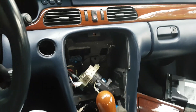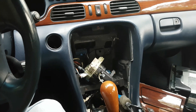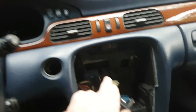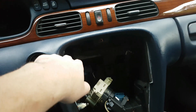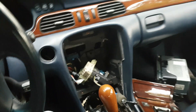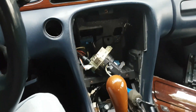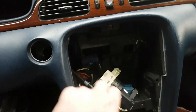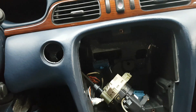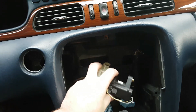I went to YouTube and couldn't remember if I'd used a video to figure it out last time, but as far as I can tell for this generation and body style of car, there's only one video showing how to change it — and like I said, that guy is cutting and prying to get it out. You don't have to mangle your car. You get your stereo out and you'll see there's a bolt there, a bolt there, two bolts in the front — one on top and one on the bottom. AllData and this other video say you need some sort of bent wrench to get up in there, but you don't.